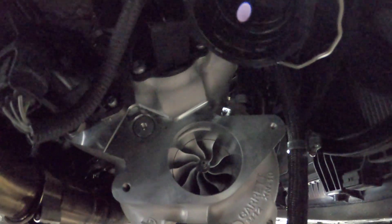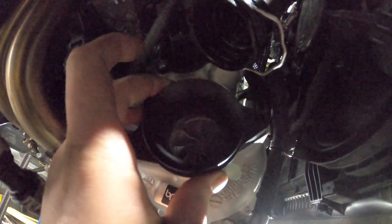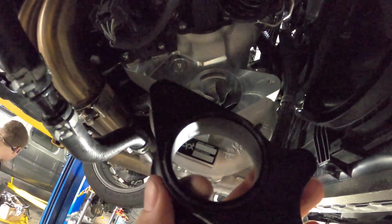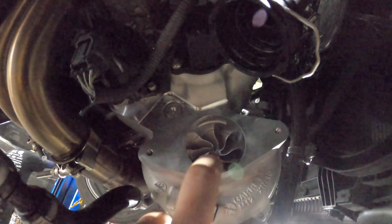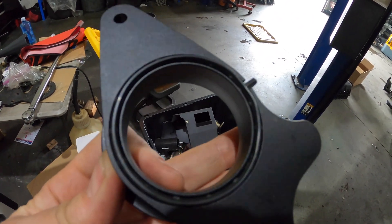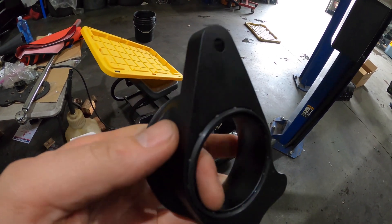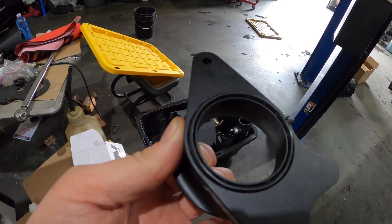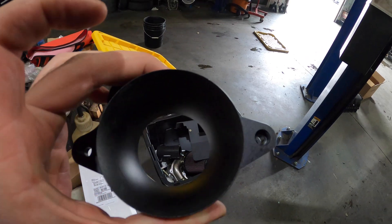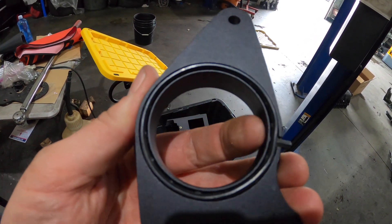Got the new turbo up in the hole and put the inlet on, and noticed there is now a step on the inside of the inlet — the inlet is a little bit smaller than the opening on the turbo. The problem is there's an o-ring retainer, so if I grind a bunch of that out we're going to have an issue with o-ring retention. I'm just going to try to radius it a little more on the inside, but there's not a lot I can do unfortunately.